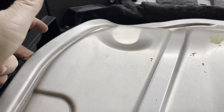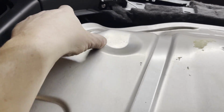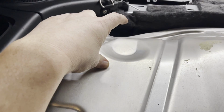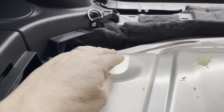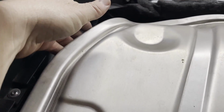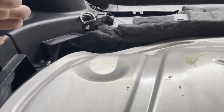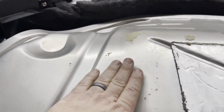It actually can be bolted down on this side, but the valve cover does stick up a bit high over here, causing a bit of interference. I think it's actually this dimple. I'm not going to do it yet, but technically I think you could flatten out this dimple and get the clearance needed to bolt the engine cover down. I'm not sure if this is actually an important contour. Maybe it has something to do with clearance for the Boxsters. At some point, I would really like to check out a Boxster and see if the engine cover is the same.